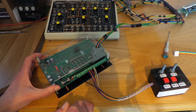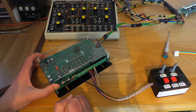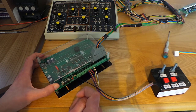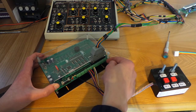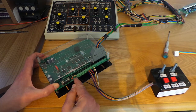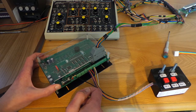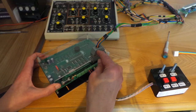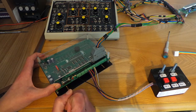Let's start by talking about the power supply, which is the ignition switch power supply from the car. That goes in on pin one of the D-type connector, or alternatively on pin one of the terminal block connectors. The terminal block connections count from right to left, so pin one is at the right looking from the back of the unit and pin 37 at the left. The ground return for the power supply is on D-type connector pin 25, or alternatively on terminal block connector pin two.